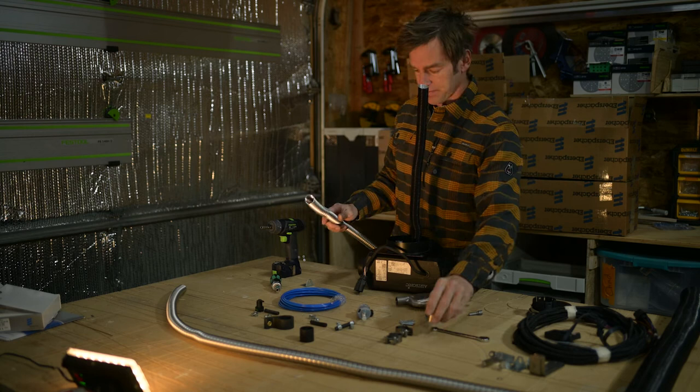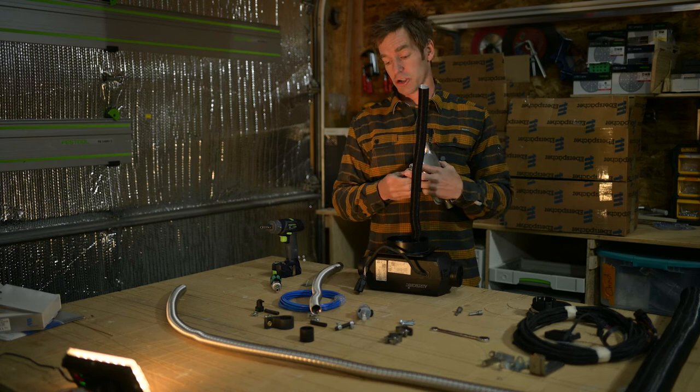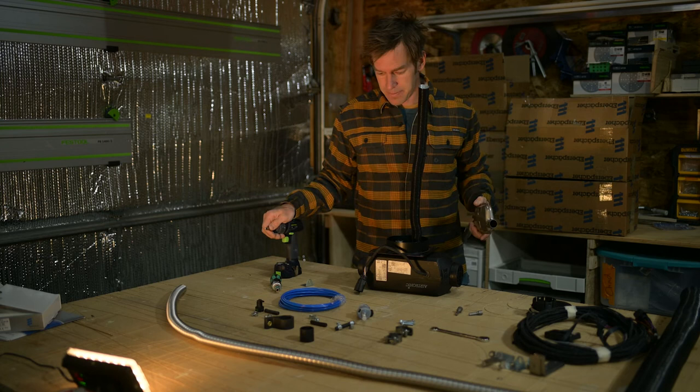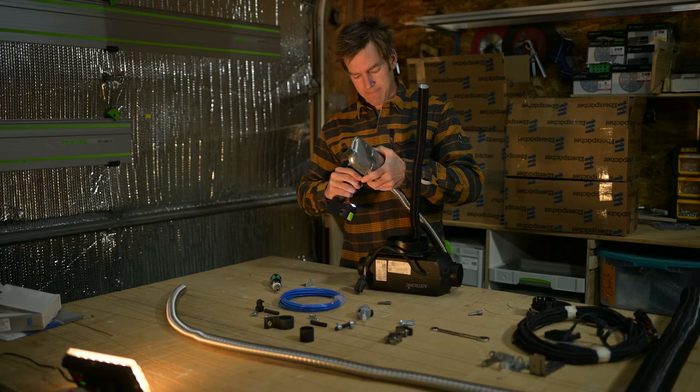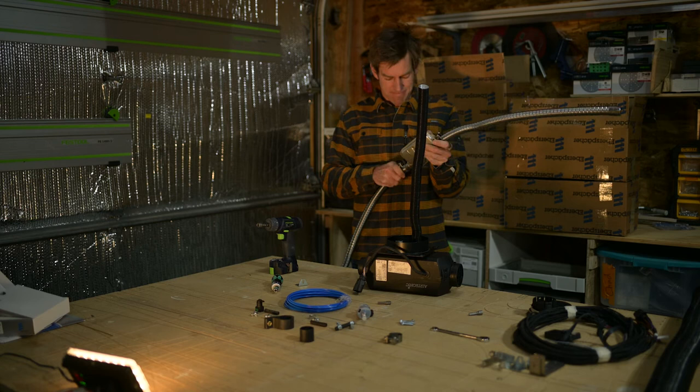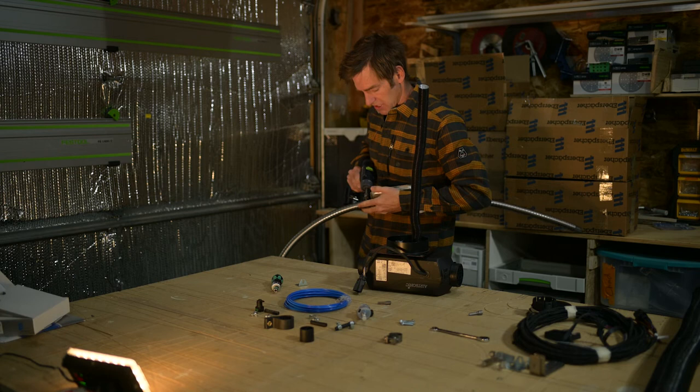You get these fat compression rings. This is for your metal tubes. They need a lot more force. There's a normal hose clamp there, and the normal hose clamps are for your air hoses, and your air hoses are normal, they compress easily. So I'm gonna just compress this on here. This is my air out from the diesel heater, and I'm just gonna put this on here. It's a nice and tight fit, and I'm just gonna compress this as well.